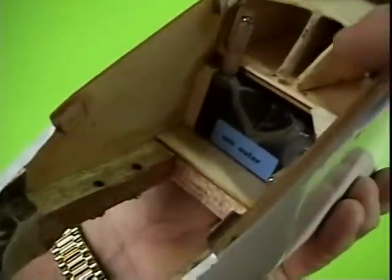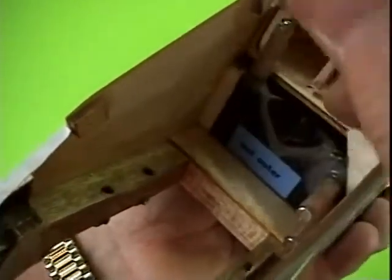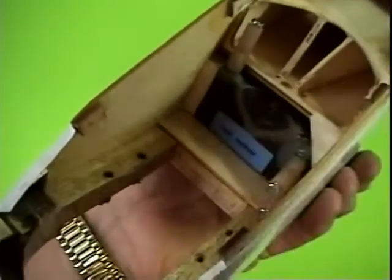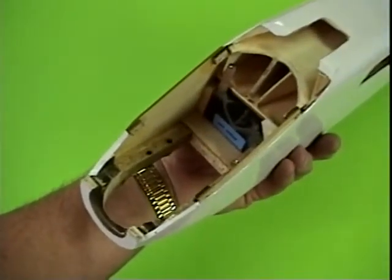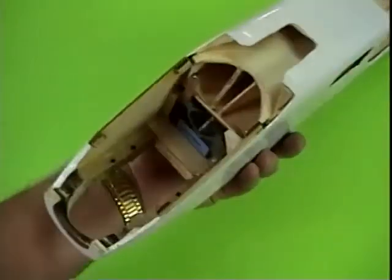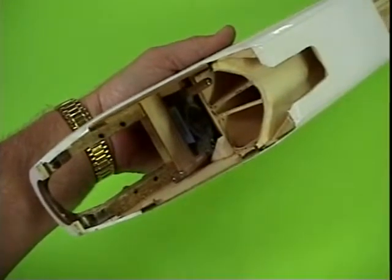Now, of course, your tank may be different than this. Metal tanks may be shimmed differently for different motors, but this is a good starting spot for a road jet. For a road jet, right off of the shim would be where I would start. Now we're ready to move on to the next step. Getting all that work done on the nose took approximately another hour. Roughly 2 hours, a little more than 2 hours into this.